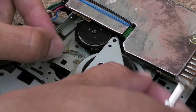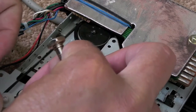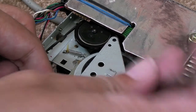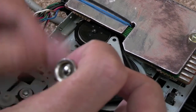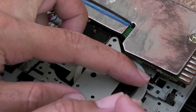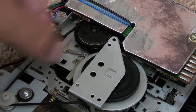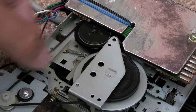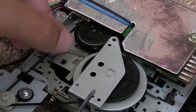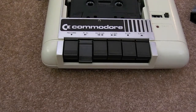Just get it to the point where it's actually hooked on — yeah, like that. As you can see, if I pull it, that's fine. Try and keep the tension and pull it over the motor fitting. Then just rotate it a little bit to seat it. It's worth pulling it around like that and paying attention to the way the rubber is sitting — make sure it's all the same way, not twisting as it goes around on either side.